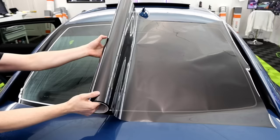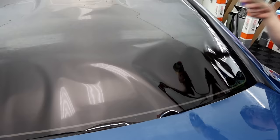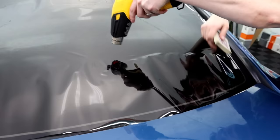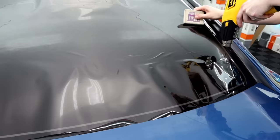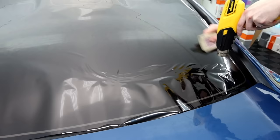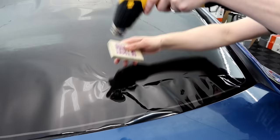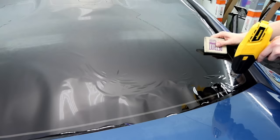So then when we switch over to something like Pro Classic, which is a nice straightforward dyed film, this stuff will just shrink so much better. I have nothing but good things to say about all their films as far as shrinking goes. But you don't just need to use Pro Classic — I'll have links in the description with some other films. I'm not just trying to be a geo pusher here. I just want you to pay attention to how much more consistent a film like this is going to be throughout the entire shrink. So you really don't have to try and change up your style. You will have to put the heat gun a little bit closer, but it still goes incredibly fast compared to what we were just doing with the Lexan.